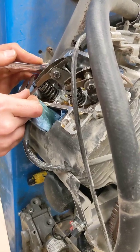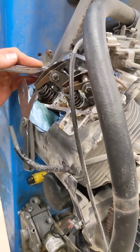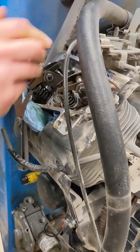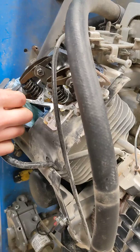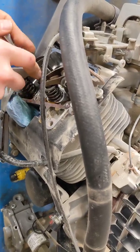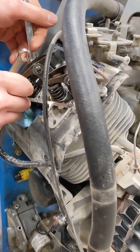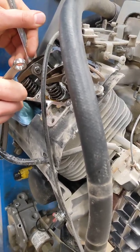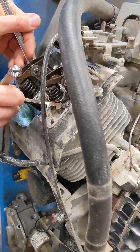You want to tighten it down on your 5,000ths — just a little snug, not a tight fit. Just so it barely holds on to that. Then with this hand, hold that wrench in place so it doesn't loosen up anymore, and tighten down the nut. That one is done. The slightest bit of motion in this wrench is enough to change the gap a pretty significant amount.